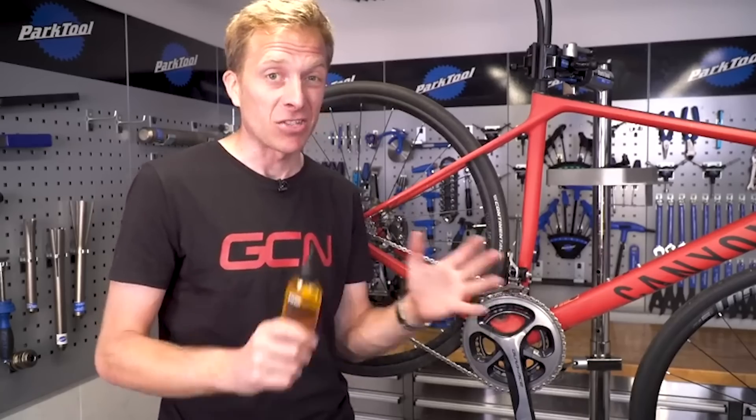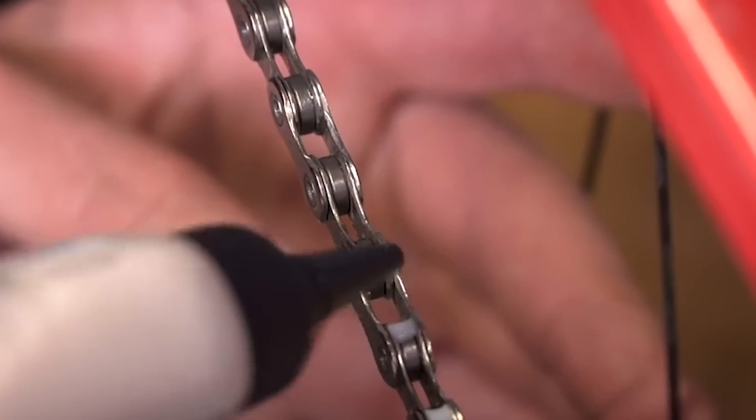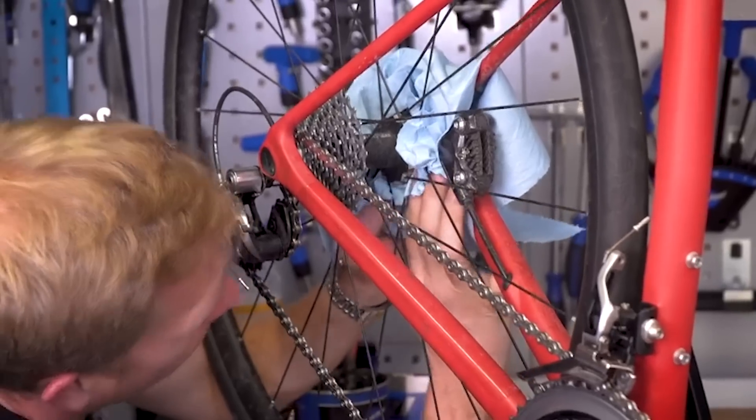What we recommend is that you completely degrease your chain — we've got a video that's going to pop up on your screen in just a second on how to do that. Really in depth, and you'll definitely have a nice shiny chain again. When it comes to re-oiling your chain, it's only the little rollers that you actually need to oil, not the plates in between. One drop per roller will keep your chain nice and clean — reapply and wipe off every now and again.